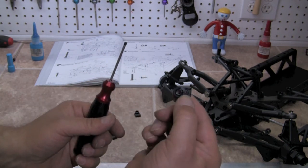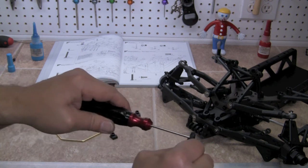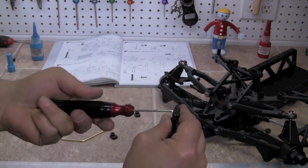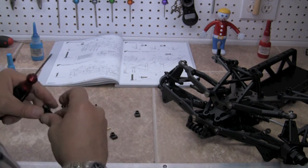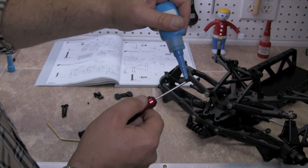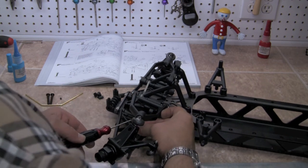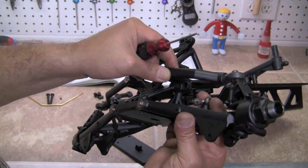Those are going to install right into the hole here. You want to screw it in just until it's about even. We're going to use those to adjust the sway bar in a little bit, so go ahead and screw both of those in. Then we're going to take the other two set screws and put them into the metal part of our sway bar link that we installed earlier. We're going to put just a small dab of Loctite on them and install them into this metal link — just a little ways in. You can see the set screw installed.